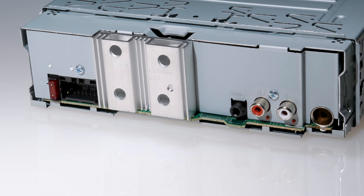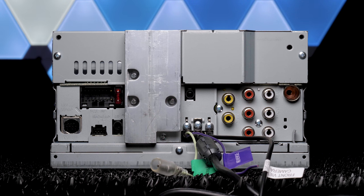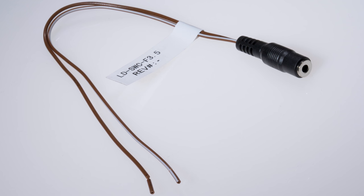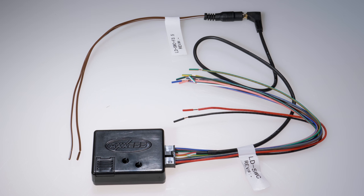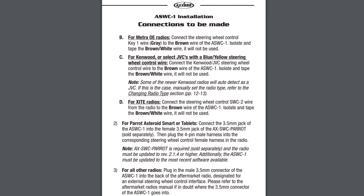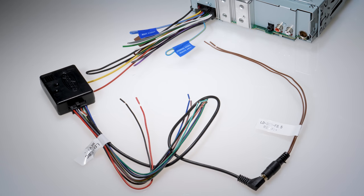News flash: not all radios have a 3.5mm steering wheel control input. Instead, they have a steering wheel control input on their harness — common with Metra, Power Acoustic, Soundstream, Kenwood, Mitsubishi Eclipse, and JVC stereos. This is where the little brown harness comes into play — the 3.5mm to two-wire adapter. Follow all the same procedures as before, except use the brown female connector to plug into the ASWC's 3.5mm connector, then connect the brown wires to the JVC/Kenwood blue and yellow steering wheel control wire, the steering wheel control wires on the Mitsubishi Eclipse, or the steering wheel control key-one wire on Power Acoustic, Soundstream, and Metra OE radios.